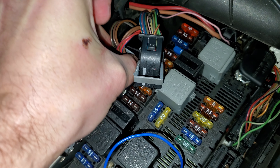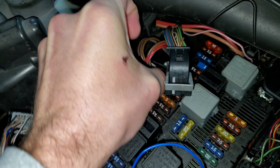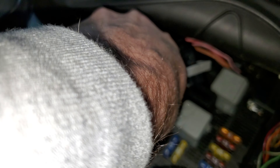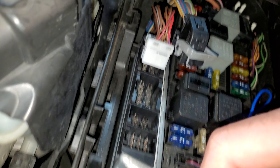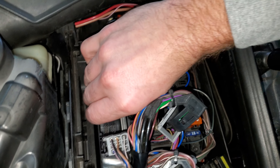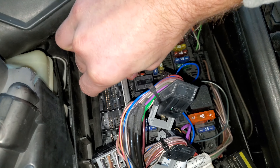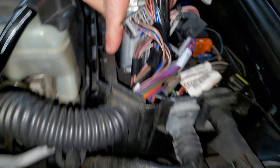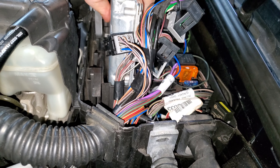It's going to be a little difficult to get again — I had to use both hands on that one. Move the wires out of the way, grab your ECU, and pull it out. There's a little holder in it too — push that down. That's where it seats down into. Go ahead and push that off.